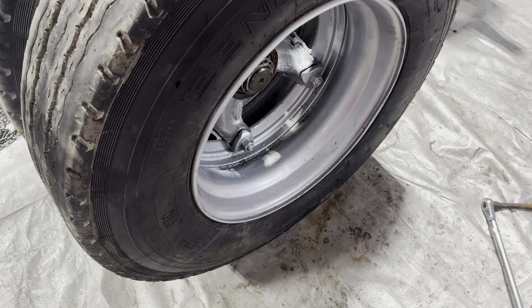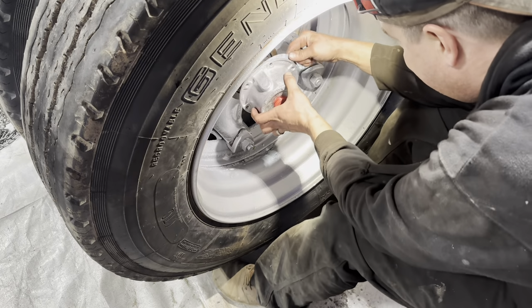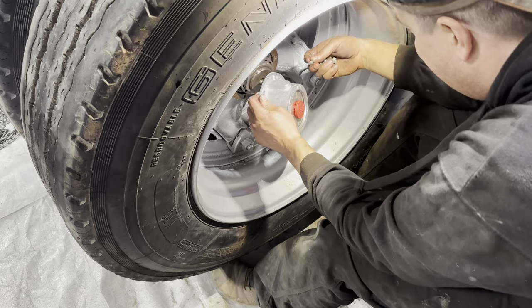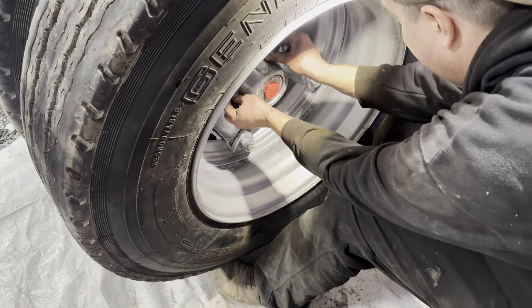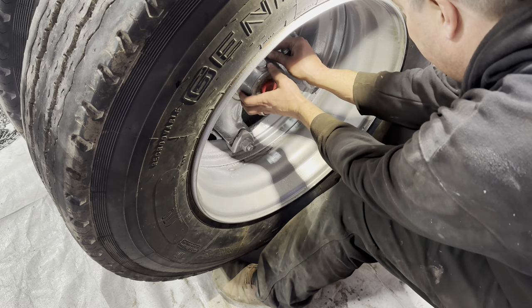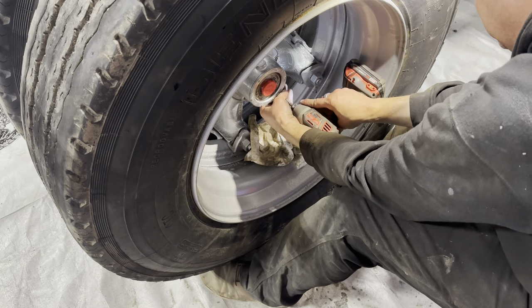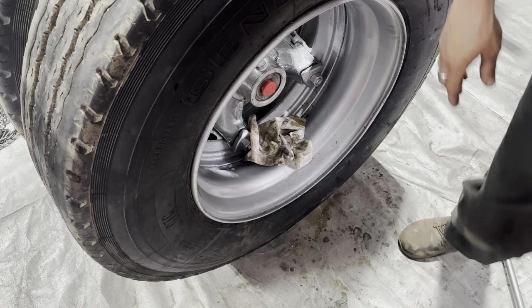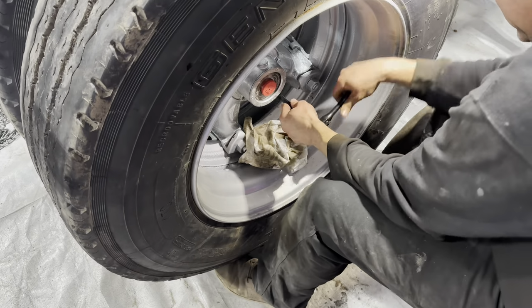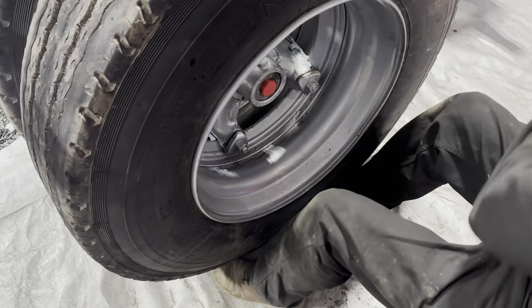Okay, so, home stretch. All right, I am so tired with oil dripping out of these hubs. It's finally gonna be the end of that. So I got new Stemco hub seals and a new gasket in there. So we'll zip these guys in. Probably check those with a ratchet just to make sure they're tight. Okay. That should be the end of the leaks.